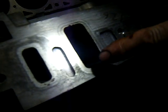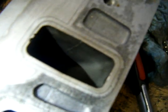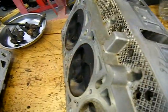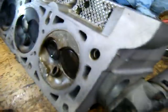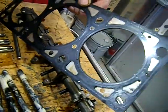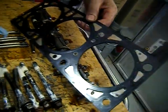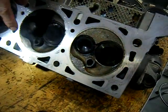Checking the gasket surfaces — you can obviously see there's a good seal all the way around. You can see the line where the gasket actually sealed properly, so it's been sealing very well all the way around on all of them. Nothing is transferring past the gasket. Double-checking the other side — you can see the seal everywhere. There's nothing wrong with the gasket seal. The head gaskets were fine, nothing wrong with them — not blowing out on the sides, not transferring from cylinder to cylinder, nothing from cylinder to a water jacket anywhere. The sealing on the heads themselves is fine.